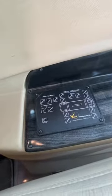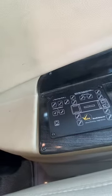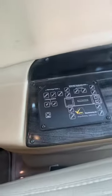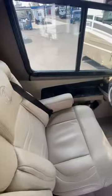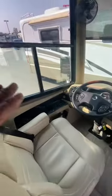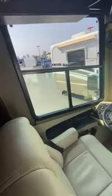These are also heated seats. There's full leveling — it's air or hydraulics, so you can have the actual foot that comes down or it levels you without that foot coming down. Imagine you're in sand or something softer and you don't want your jacks to get stuck in the dirt — you can level out using the air system, which works amazingly. You can also raise and lower the entire coach. That's sometimes useful for getting up into tight spots — a steep driveway — you can give yourself another five or six inches of lift, just to roll into a steeper incline or going down a curb, coming out of a gas station or your own driveway without having to scrape anything.